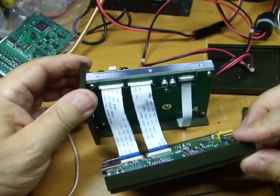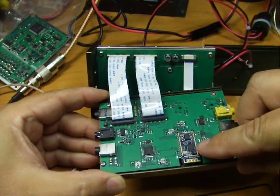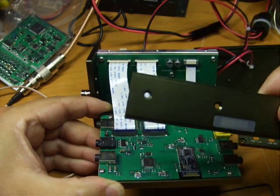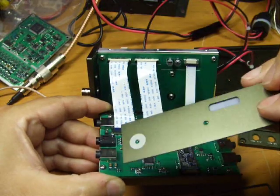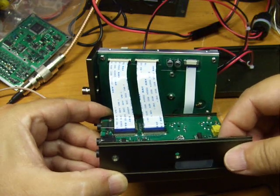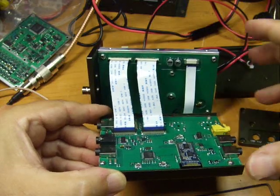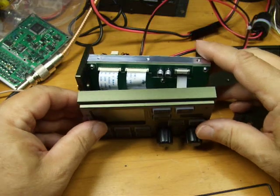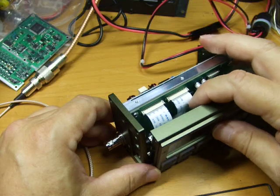Before I do that — error of omission — on the inside of this board, you see this module here. This is the Bluetooth module. And this is the plate that's going to go on top of it. When you put this plate on, this plastic part, which is open, has to match where the antenna is for the wi-fi. Because if you don't do that, the wi-fi won't work worth a damn. So just bear that in mind when putting that together. I'm going to carefully guide this back in so that we're not gouging the ribbon cables.